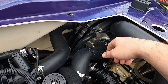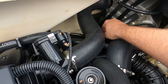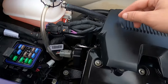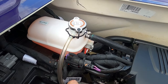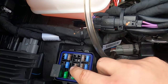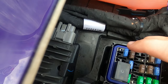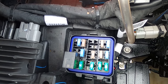My camera was running low on battery so I just routed it through — you can see I'm using my hand to wiggle the cord. I routed it through on the intake side and I'll keep it off to the side. I'm not going to zip tie it down until I've put it into the fuse panel. I pulled the fuse panel — obviously pull the top off first — and there are rubber bungs in there, basically just to stop moisture from getting into the ski. You're going to pop out the one between these two 30-amp fuses and the one immediately above this 15-amp fuse.